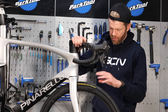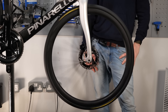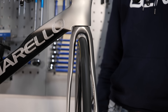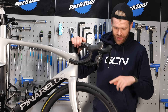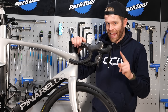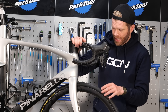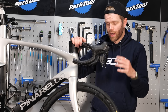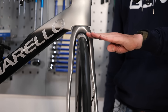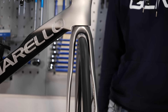Something I'd recommend is with the tire on, get the bike up and just spin the wheel. This helps circulate the sealant around the entire tire and rim, which helps seal it against the edge of the bead - the centrifugal force just forces it out everywhere. It also allows you to check how the tire is seated. If you're still leaking and not holding air, it might be because the tire is not fully properly seated all the way around - you'll be able to tell by looking at the tire in relation to the fork blades, and you'll see any bumps where it's not properly seated.